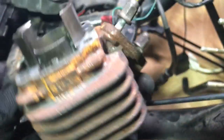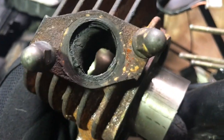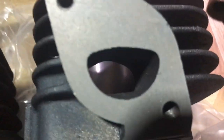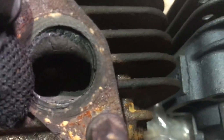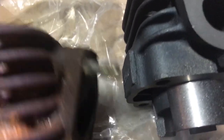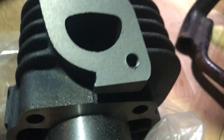Look at that port right there. Let's compare and contrast that port with the new port. The exhaust port is much sharper on the new one — you can see it. That's the exhaust port on the original RH50 cylinder. The most notable difference I notice is that this new cylinder comes with built-in exhaust screws — two exhaust screws built into the head — but the original doesn't have any bolts.